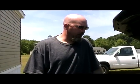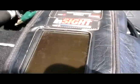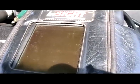Now the cam sensor, suspected of being faulty, but I still got to see it fail. I mean, what can that take? If this truck isn't throwing 340 every couple weeks, I'm in the shop and it's not doing it now. What can you do? So what I want to do now is watch this thing on a scope, and I want to just tap the cam sensor with a small tool. Again, you gotta be careful. You got that belt spinning, that fan moving.